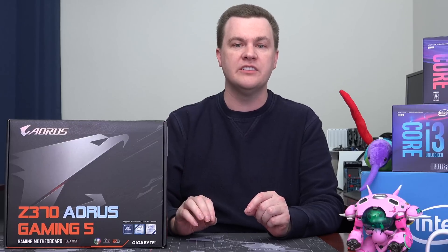It does have a bunch of USB features including USB 3 Gen 2 at 10 gigabit per second. It has tons of RGB and a bunch of RGB headers — both analog as well as the new digital header — so you can connect a large amount of RGB cables if you want. It includes Intel Gigabit Ethernet LAN as well as Intel AC Wi-Fi, but please note it is only 1x1, so it's a single channel. It's not as fast as a 2x2 connection — if you want low-latency gaming Wi-Fi you really want an add-in card.